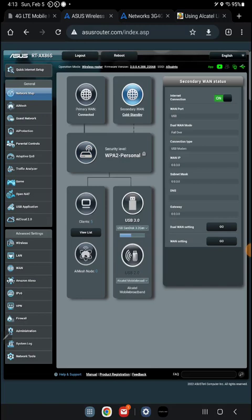That's not where I want to go. Is it this? Yes. Okay, I'm sorry. So here is the actual interface configuration right now. Notice it has no IP address. That's really the issue. If you had the ability to put a static address in, then it would have a position on the network. It would have an address and a network visibility to the router. But because DHCP is enabled and it hasn't gotten an address, you can't see into that subnet. And that means you can't manage that device through the network until it's connected.